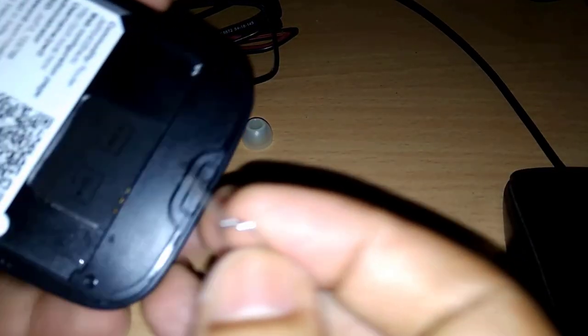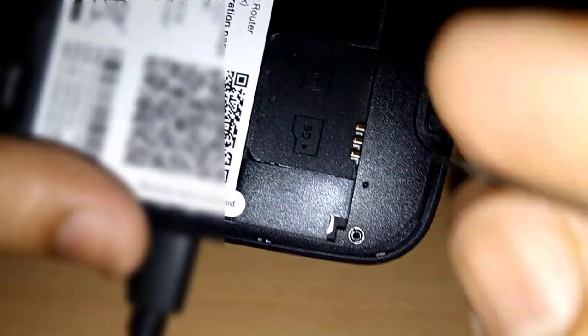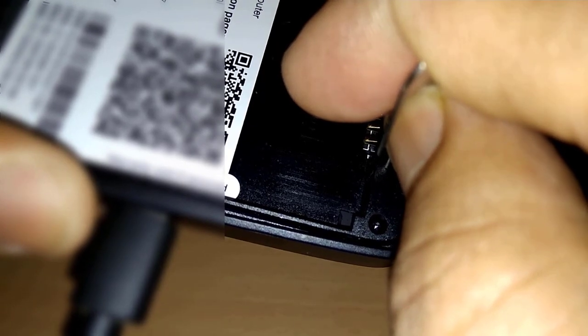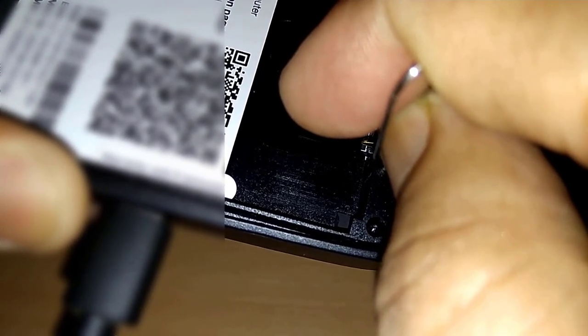We have to bring the router into fastboot mode. The best way is to look where the charging pin is where you plug the battery — there is a tiny hole next to it. What you need to do is use the SIM ejecting tool, push it into that tiny hole and hold it for at least 10 to 15 seconds. There is a small sub-button inside. Make sure the USB data cable is already connected from the router to the PC before doing this. Now my router is in fastboot mode and it is directly connected via USB cable. Keep the router as it is — it is now in fastboot mode.